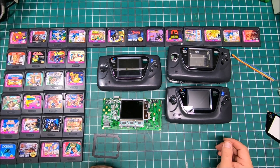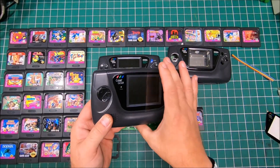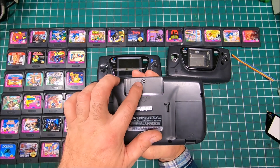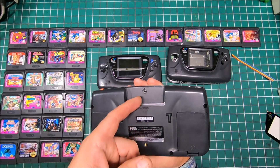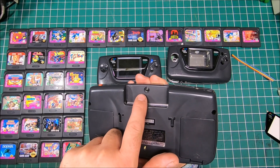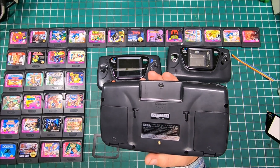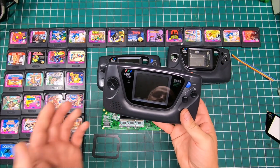That's a pretty simple and straightforward modification. Also, when I installed the glass, I addressed the back of the unit — when you do this mod there's a screw post that needs to be trimmed. I cut that post shorter, glued it back, and trimmed the original screw as well, just to make it look like the system was never modded. From behind, the first hint that a system has been modded is usually a missing screw, so I wanted to keep that intact.